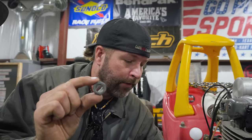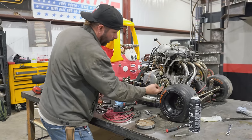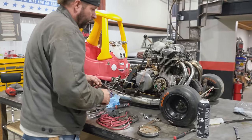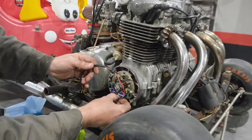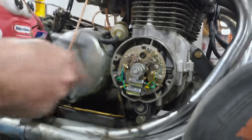That's not good because that'll be like redlining — we're going to be cooking some stuff. We need to cut that signal to one-fifth. I've got a washer installed on the crankshaft — that's going to be my reference signal. I'm going to hot glue this right here, and it's going to be picking up on that piece of metal right there every revolution. We'll let that set up a little bit.